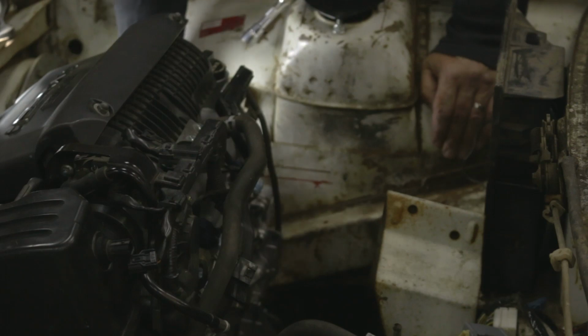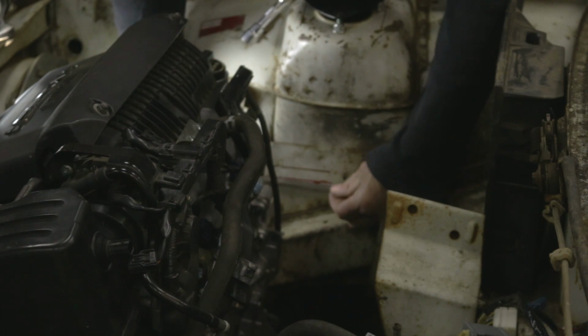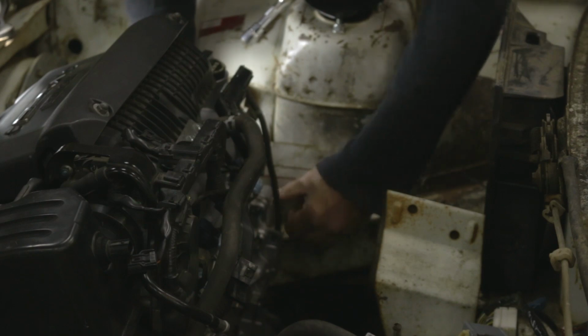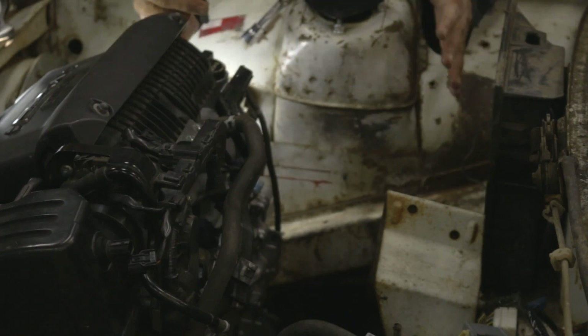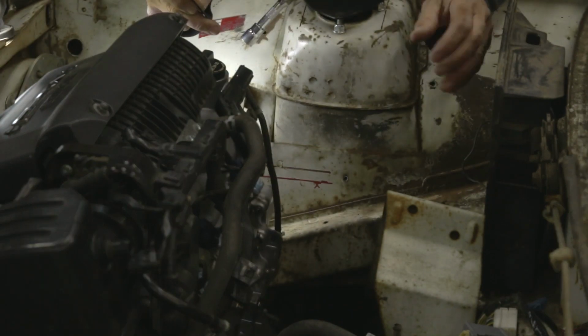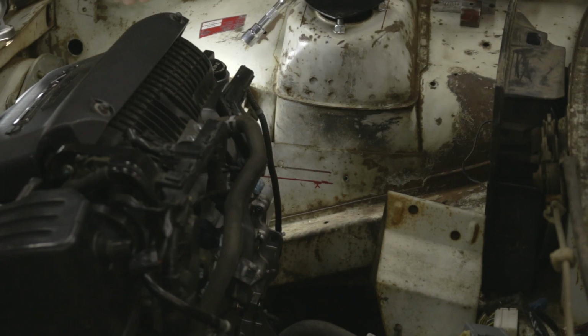And it turns out that when the engine is tilted back the appropriate amount, this red line here is the equivalent engine mount height from the engine. So it's actually almost completely parallel. And that is a nice thing to be able to continue to work with. That makes things a little bit easier to keep everything equal side to side, going by what has already been established.